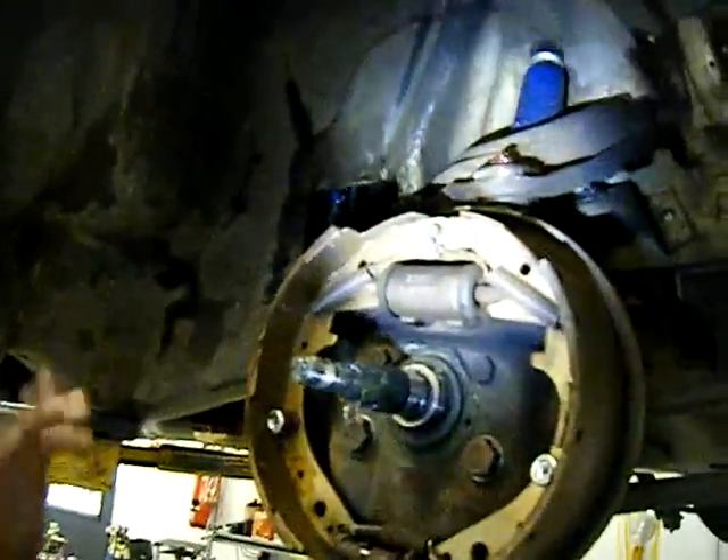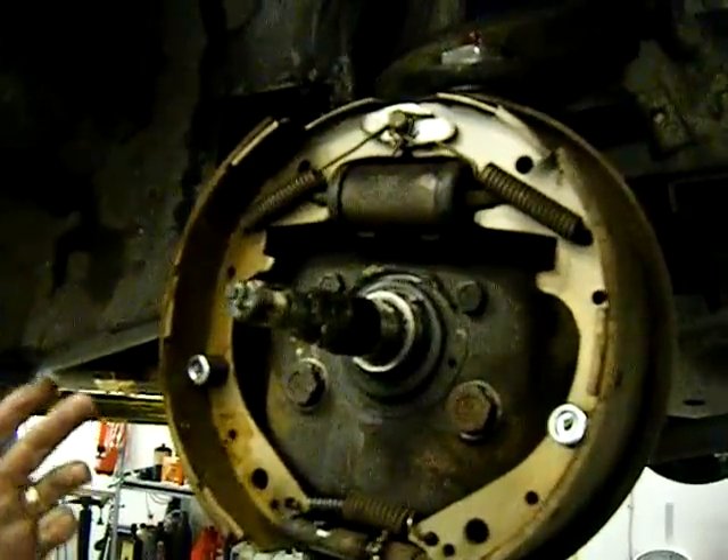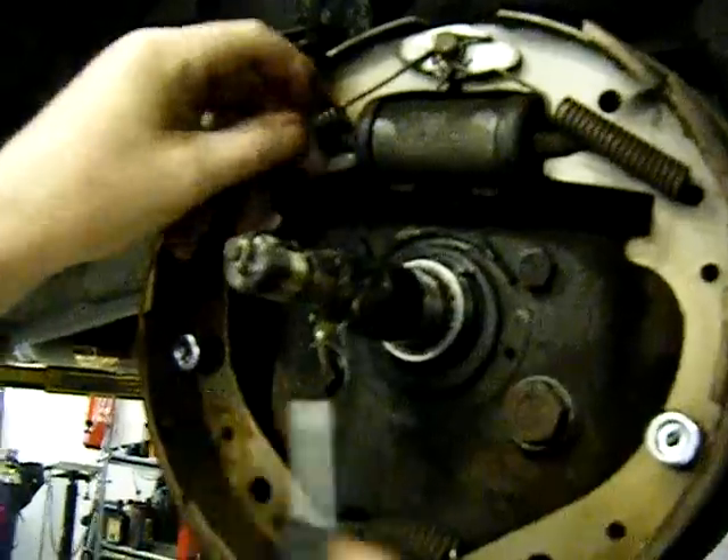So far what I've found: I took the wheels off. I like to take a look at the brakes. Brake shoe lining is good. Wheel cylinders always look good, but let's take a look here. I like to peel them back a little bit. You can see fluid here — when you see fluid on the inside, it's actually come past the seal. That's not a good sign, so this wheel cylinder needs to be replaced.